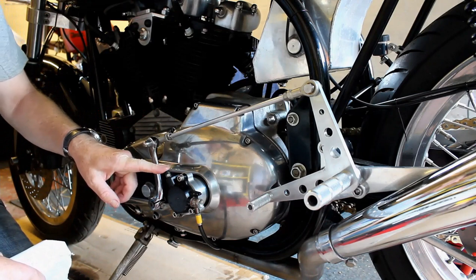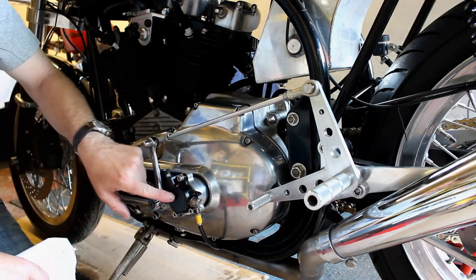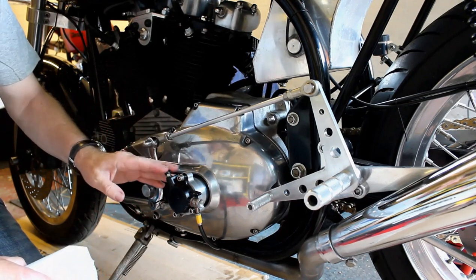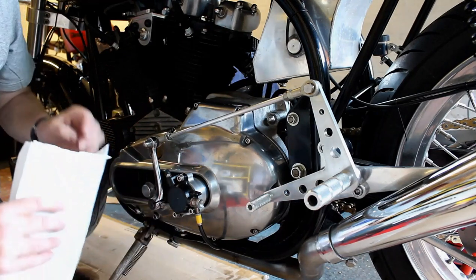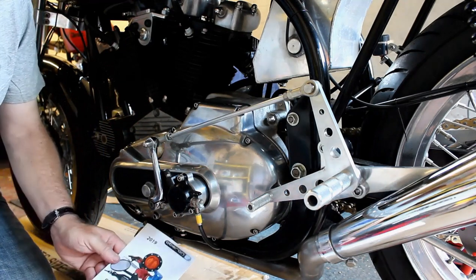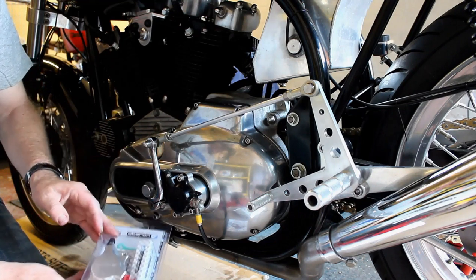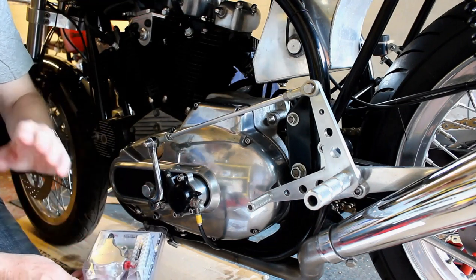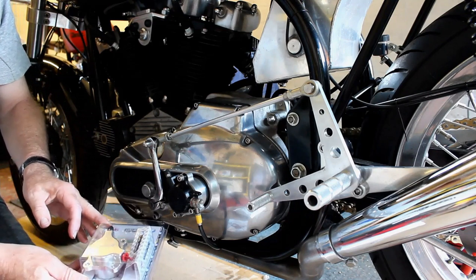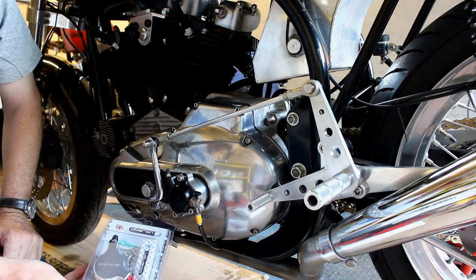What we've got is a homemade hydraulic clutch conversion. The bike was originally cable clutch but I converted it to hydraulic using a slave cylinder from a Honda Blackbird and this adapter. Nothing wrong with it, it works well but could look better. In this parcel we have an upgrade from Oberon — it's made to fit a Honda Blackbird, so hopefully it's just a case of unbolt, bolt on, and bleed.